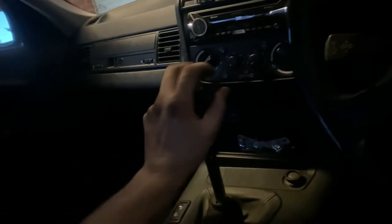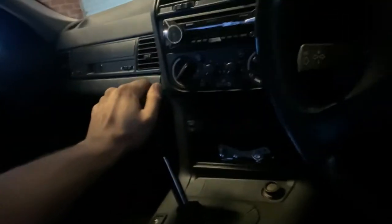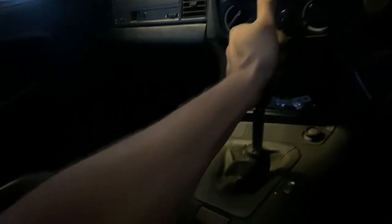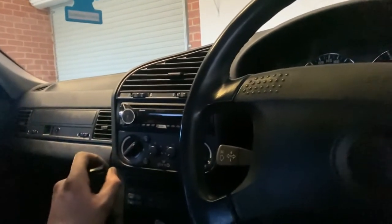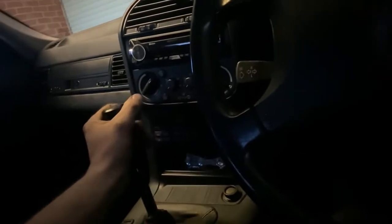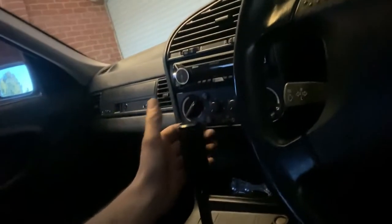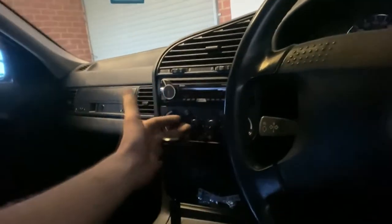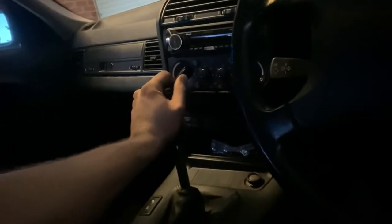Here's how she sits. It does go into all the gears, which is nice. Reverse doesn't get too much — it's kind of a satisfying clunk when it goes in. 5th is real easy to get into; it's basically where 3rd used to be. 3rd and 1st I've got to be careful with — 1st is there and 3rd is just up and slightly to the left from the middle. If I push straight up from centre it actually goes into 5th rather than 3rd.